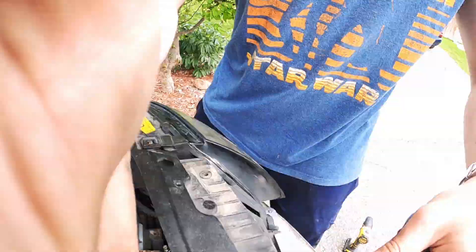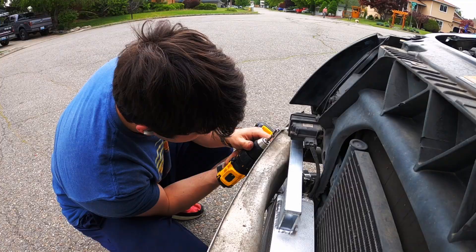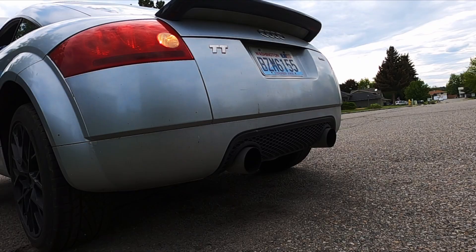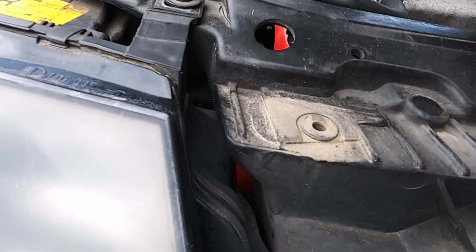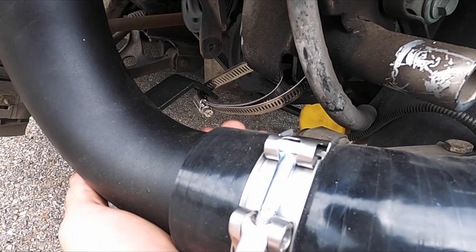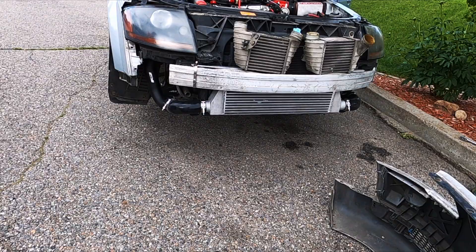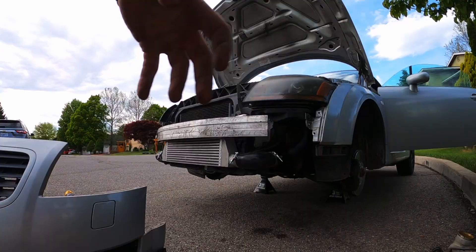While I still have the bumper off, I want to start it up and see if it idles and runs okay. I specifically went through and checked the fittings on all of the hoses and pipes we touched to put the front-mount intercooler in place. The dead giveaway that we did this correctly was that my idle vacuum pressure on startup was identical to before we put it on. Looks like the car's running just as I expected. Before putting the bumper back on, I decided to place the original intercoolers next to the newly installed front-mount intercooler. From a size standpoint, the front-mount intercooler is about the size of three of the standard intercoolers, so it definitely makes sense that it cools better and is rated to handle a lot more horsepower.